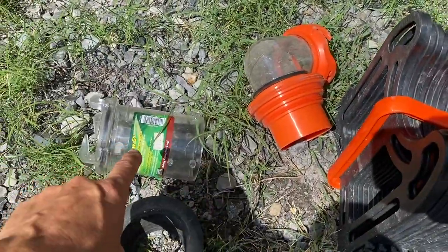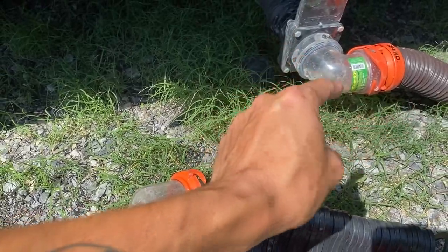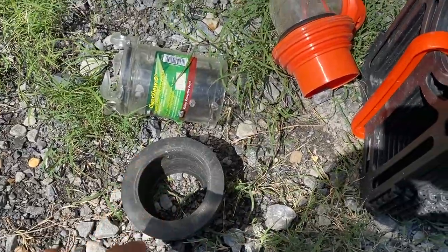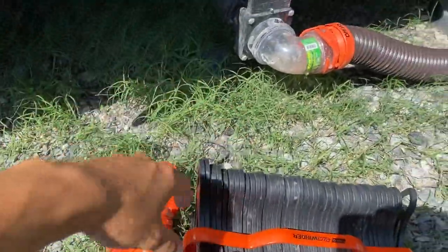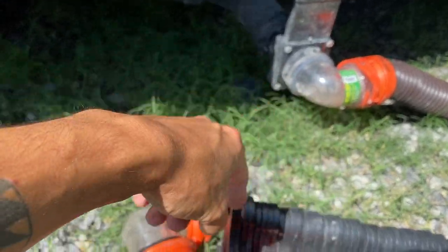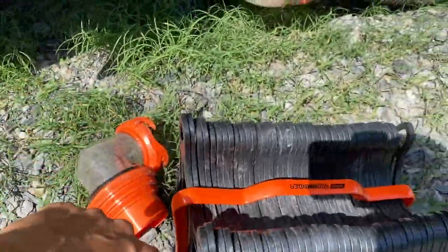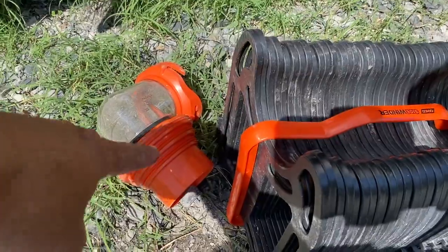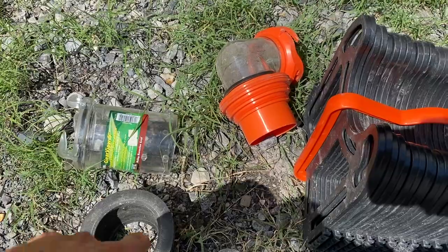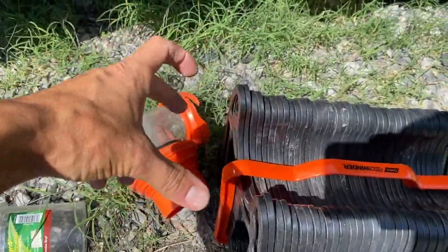You're also going to want to consider a straight or 90-degree elbow so you can see what's coming out at the end and make sure it's coming out clear. The last thing is these donuts. These donuts aren't used very often, but sometimes you get to a sewer and it's just a hole — no threads to put the connector on. You need that donut to seal your hose into it; the donut just goes over the end and slips in, sealing it onto those connections that are literally just a hole in the ground.